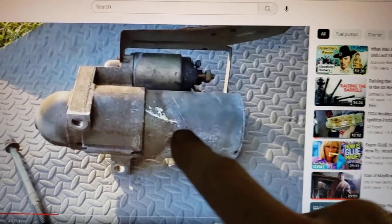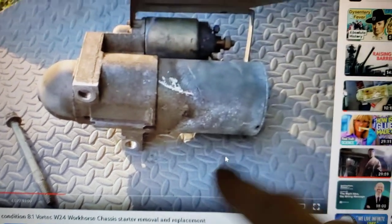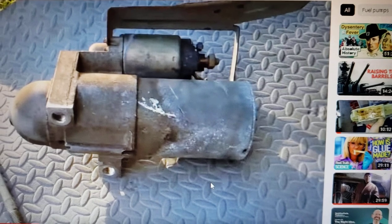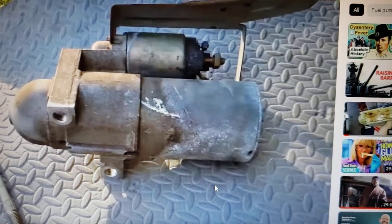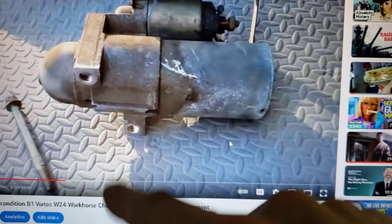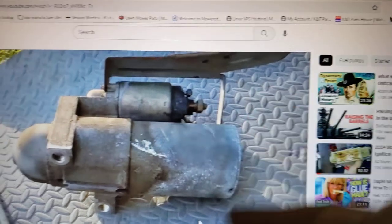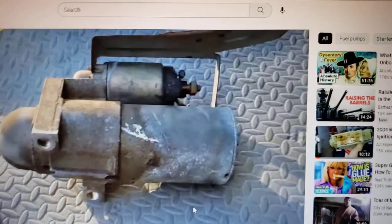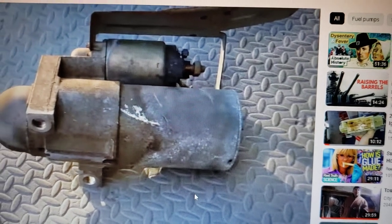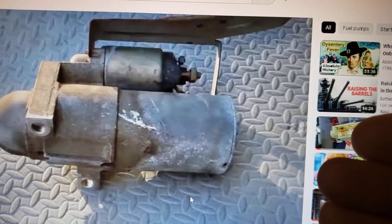The picture you're looking at right now — this is a video I did going back about six years ago. I had a no-start situation on our RV and it turned out the starter was fine, it was just a bad solenoid. I did that video removing the starter and replacing just the solenoid, and it still works fine to this day. But I'm about to get to 75,000 miles so I may drop the starter to check the condition of the brushes.